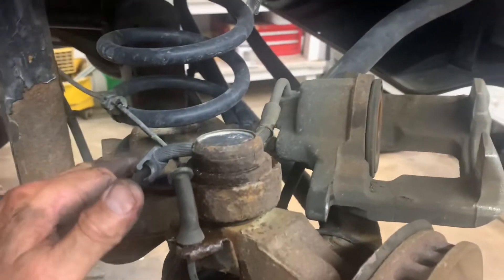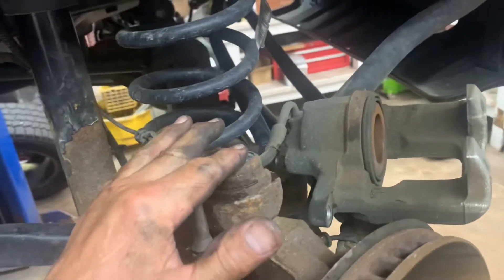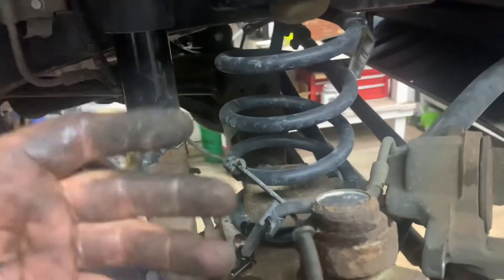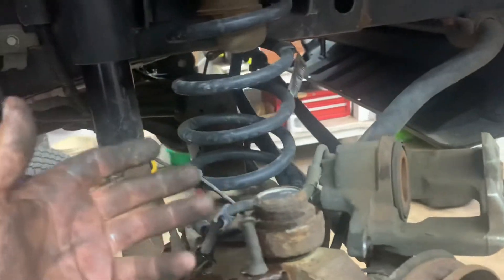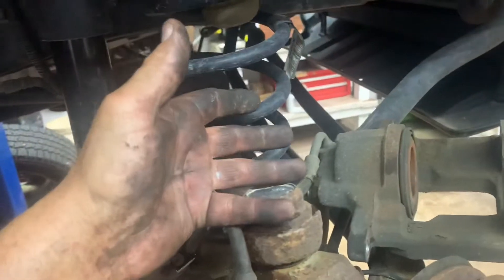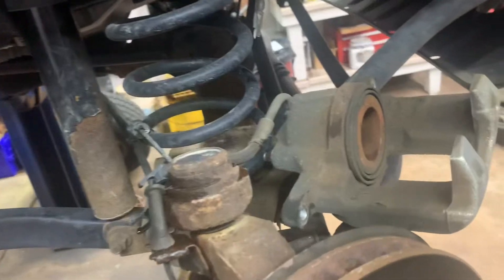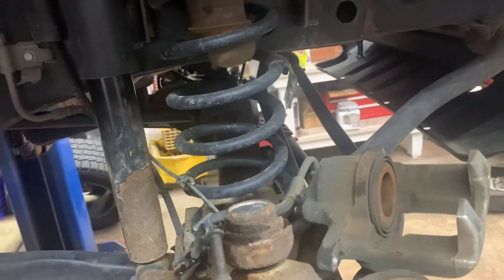When you're doing your brake hoses, do the other side too. I was just going to replace one side, but as I was replacing the brake pads the other side was really hard to push in. So don't chance it — always replace brake hoses as a pair.